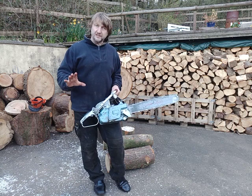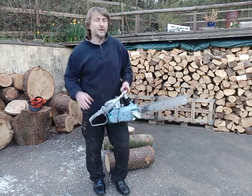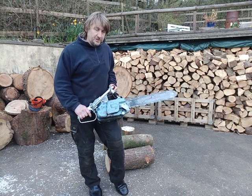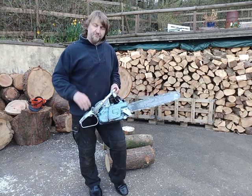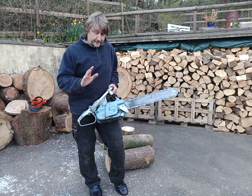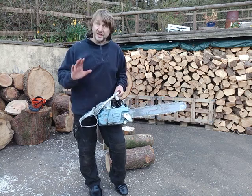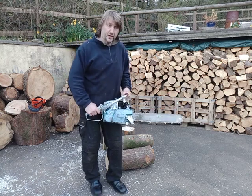The Tillotson carb would always come standard with a rubber diaphragm, or a rubber pump in the carburetor for the chamber. So occasionally on some of these, when I've been running them, I find they're old girls, so sometimes getting the sweet spot right for the fueling can be a challenge, or it can seem like it changes with the environment quite considerably.